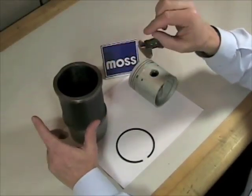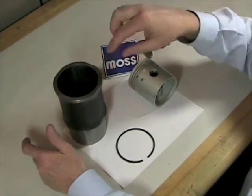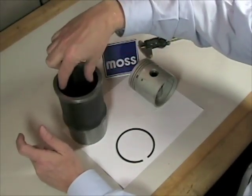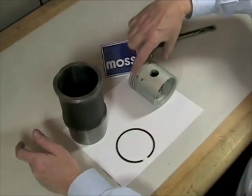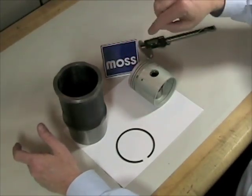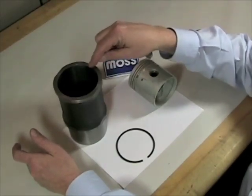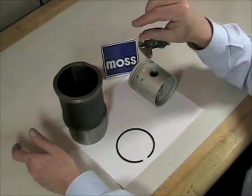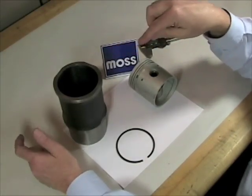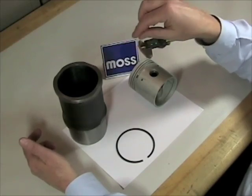What we really want to be looking for now is what the difference is, or what's called piston clearance. We take the diameter that we've measured in here, we measure the outside diameter at its widest point of the piston, we subtract the outside dimension of the piston from the inside dimension of the cylinder, and we're left with that little gap between the two. This is called piston clearance, and your shop manual will tell you the maximum allowable piston clearance.